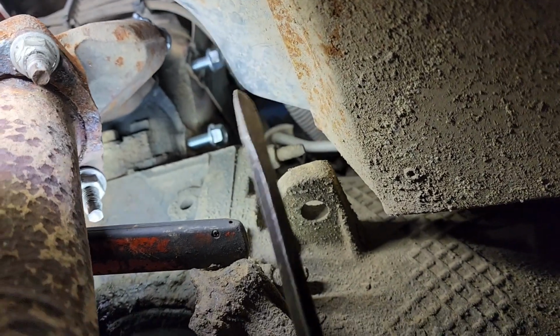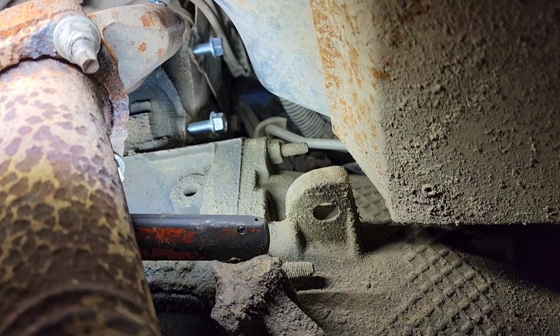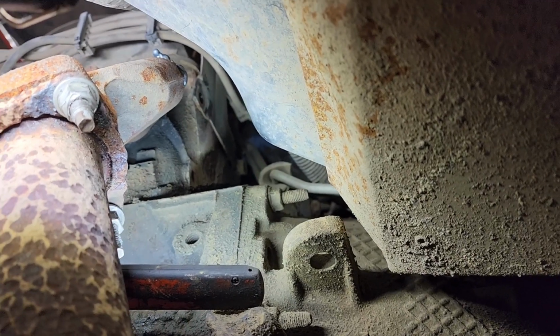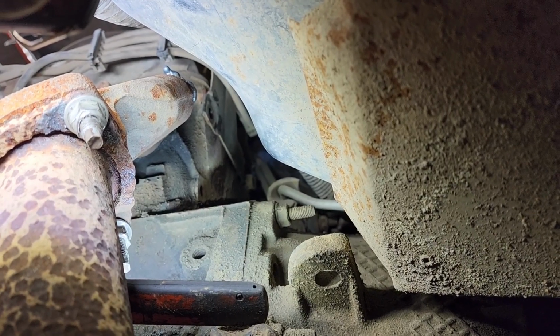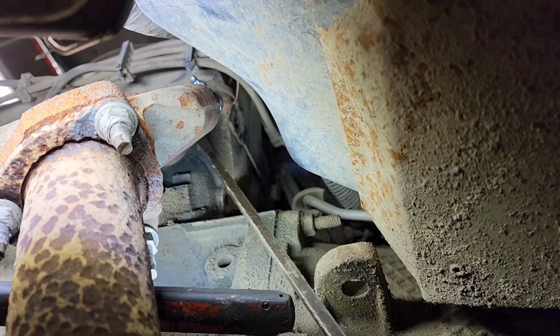Okay, to start off with, you're going to want to take the bolt out up here that holds your existing bracket. Like I say, some of them have this bracket, some don't, but this one does have it. We're going to remove the bolt. And I'm going to remove this bolt that I stuck in here just for your viewing. Normally there would never be a bolt in that hole, and that's the one that you'd want to clean out with some cleaner and maybe a tap, but like I say, maybe just a bolt. You do not have to clean the bolt hole out very deep because we use a very short bolt in our kit. All right, and like I say, we do have the bolt broken off on the back of the manifold. You can see the soot stain where it leaked around here.